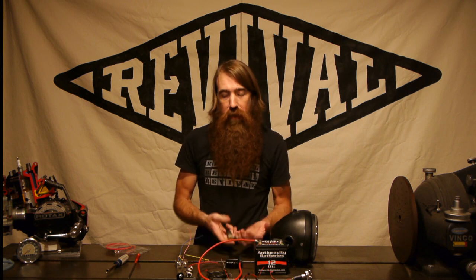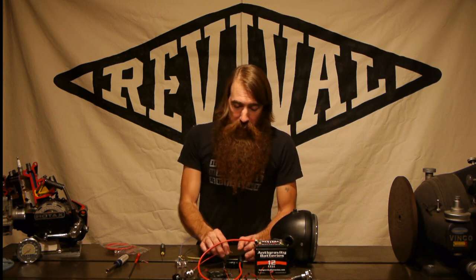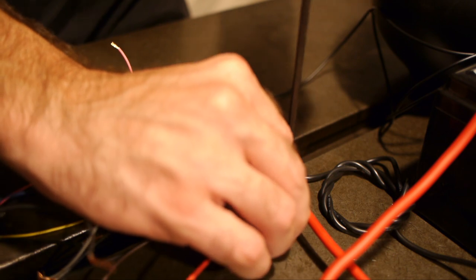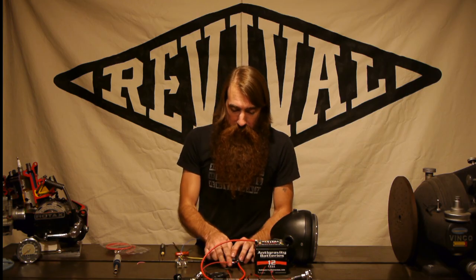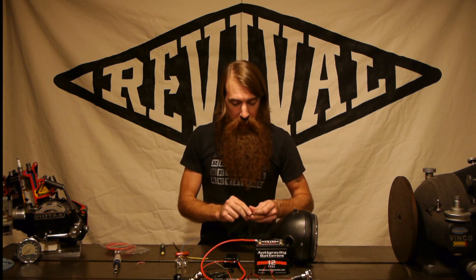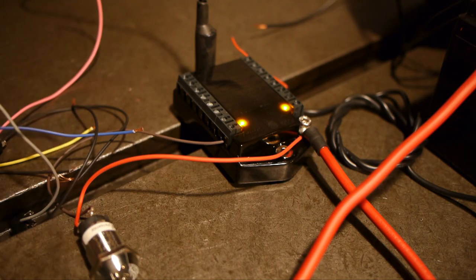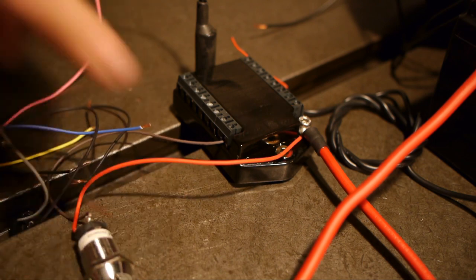These are basic screw terminals, which makes the system reusable. If you start a new project, you can remove the M unit and install it without having to cut wires — just pull everything apart, move it to the next bike, and hook it all back up. The lock input is looking for a plus 12 volt signal, so we run that to the positive terminal. We also need a ground — in your install it's important to have a very good ground to your chassis. When we turn the system on, the lights race around, then the lock input and auxiliary output are lit, confirming the system is working.